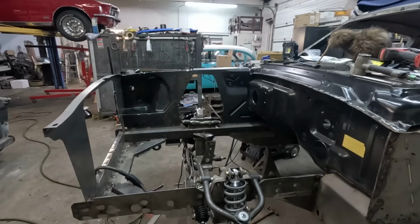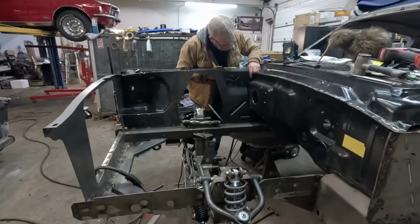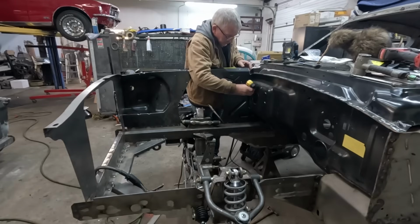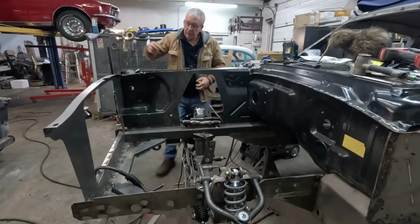And when we measure off the donor pieces, which is just out of shot, you're going to have to take my word for it, we got 4 3/8 on the original one, so we're a little bit out there, which is not surprising given that that's just where it happened to land. So we're about 1/4 of an inch away there. Put that to there. That's 4 3/8.